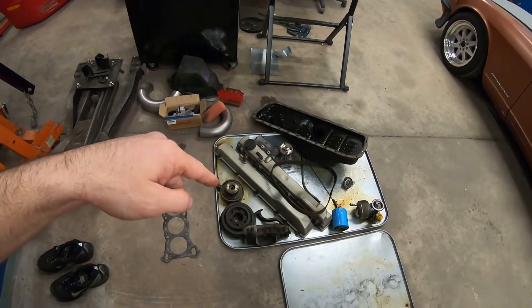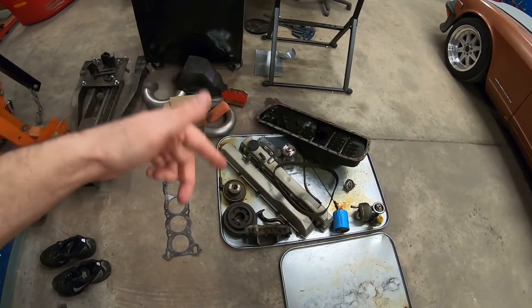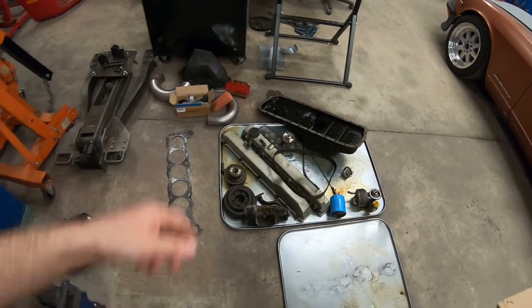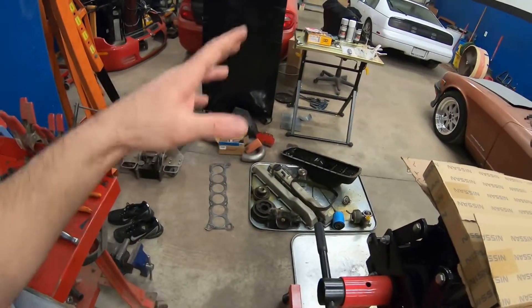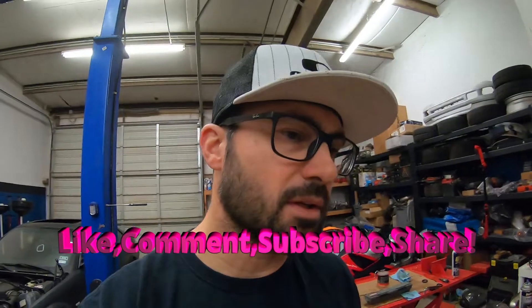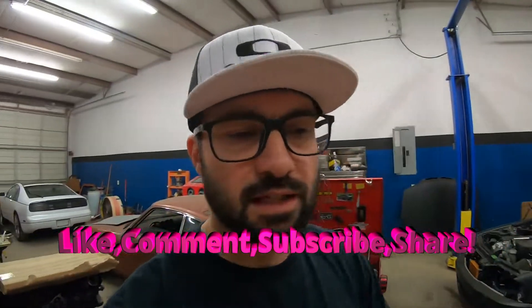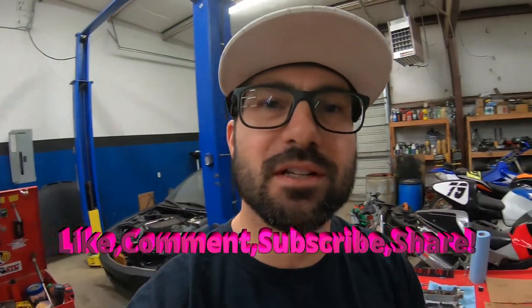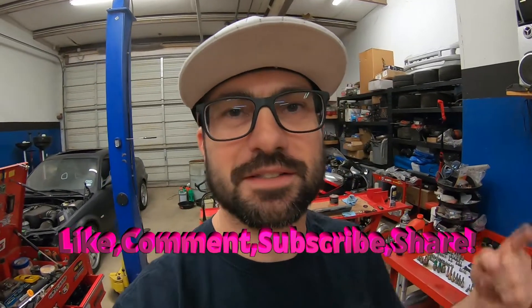What I have left to do is the oil pump. I have to tear it down, ensure the gearing is good inside, then mask the whole inside off with electrical tape - including the orifices where the spring sits for the pressure - and run the casing through the bead blaster and paint it the same way. Then I'll reassemble the whole thing. If I screwed up, I'll just have to buy a new one. I apologize for the episode taking such a long time - life gets in the way with personal maintenance. To new subscribers, thank you very much. Stay tuned, lots of good content coming on this build. Like, comment, subscribe, and share. See you guys on the next episode.